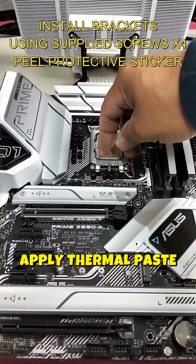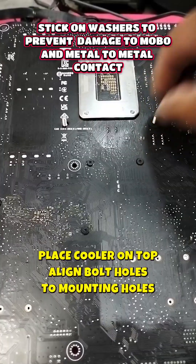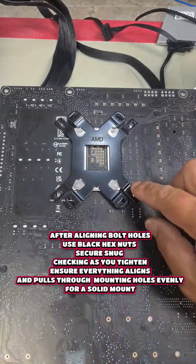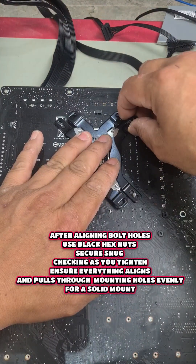It's adjustable. Apply thermal paste, place our cooler on top, apply the stick-on washers, and then apply the black hex nuts. Apply your mounting bracket, make sure all the thread comes through, and align it perfectly center.